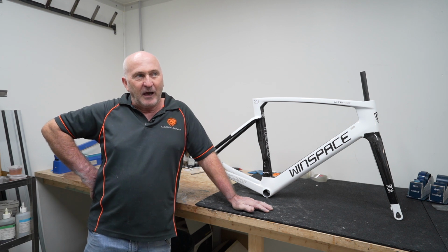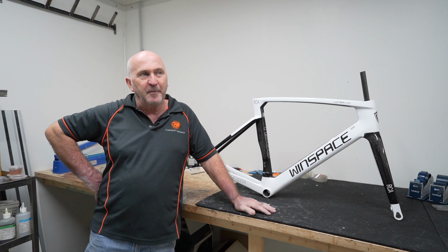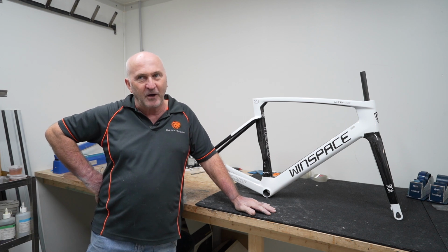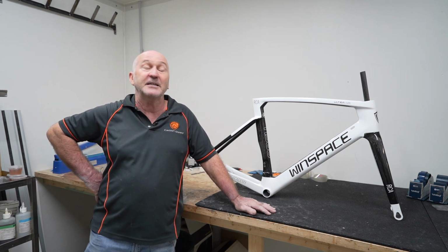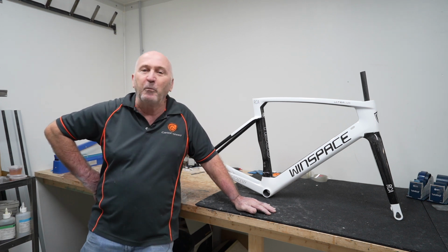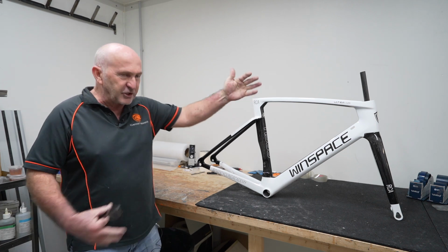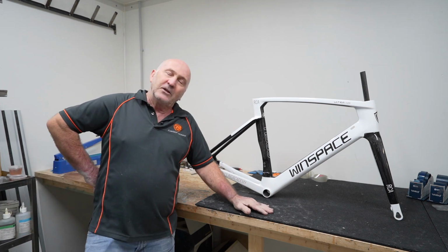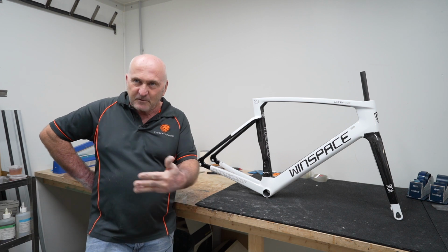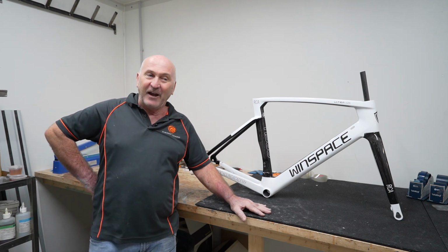Yes. I got really into researching flash thermography, and I thought it was quite amazing, but I didn't want to spend the $200K that it takes to get to that level. 200 grand, wow. Yeah. Okay. And that works by giving it an instant pulse of light, which gives it some heat, and you check out the thermal flow going through it. So I kind of worked out a way to do it for a lot less money. Yes. And it just works amazing.